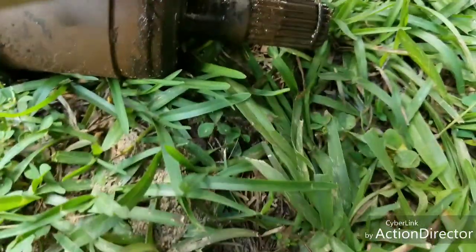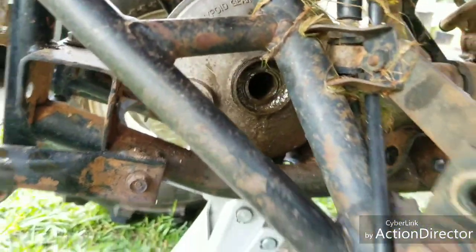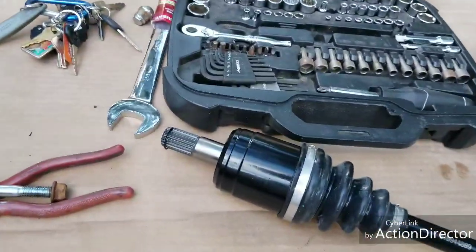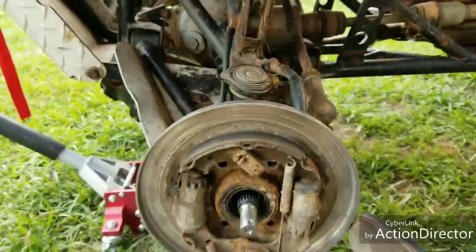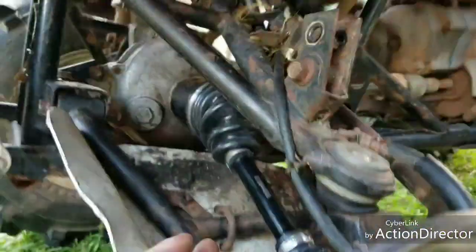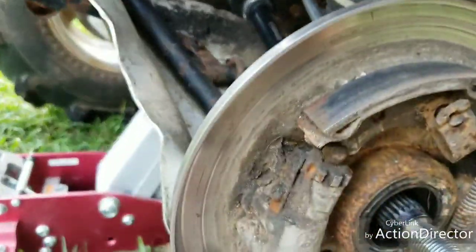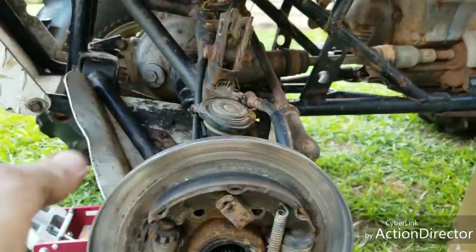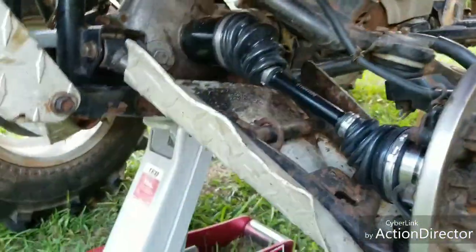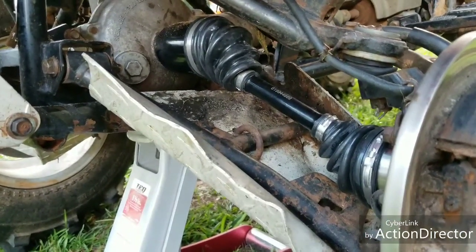There's the axle - pretty sweet. The one I took out still had the pin attached - it must not have been all the way in because there was a gap and a lot of water got in. The new one should hold good. To stick the axle in, I took a pair of pliers and beat it until it slid in - there's no other way around it. It's much easier if you drop your A-arms and swing it around, then the axle comes straight out.